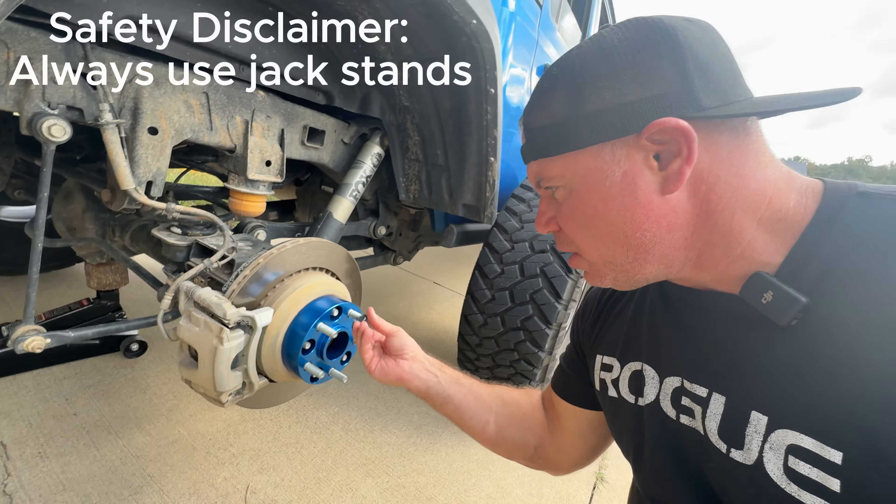I don't know what the gas mileage is going to be. I essentially added about 28 to 35 pounds with those four wheel spacers plus additional lugs, so I don't know if that'll make a huge difference, but it's definitely going to add some wear and tear to my drivetrain and suspension geometry. That wasn't really all that hard - once you figure out what you're doing, it's nothing more than taking tires off, putting spacers on, and doubling up on your lug torque. I did torque these to 135 foot-pounds - it does say 130 - drive them for 50 miles and recheck. I'm going to reset the odometer right now to measure that 50 miles, recheck it, and maybe I'll post a short about that.